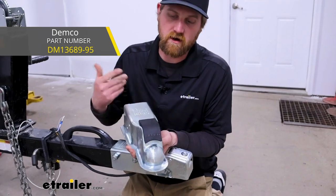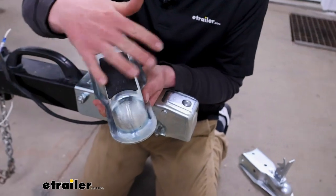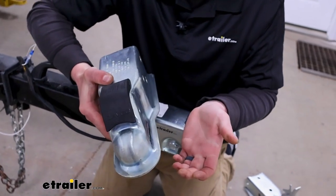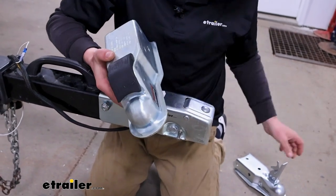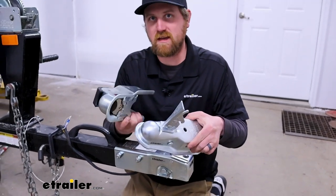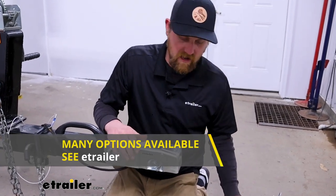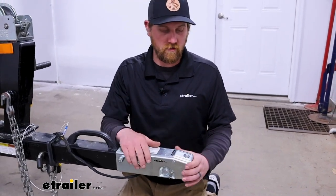Like this Demco one — these are actually pretty cool. It's an easy-latch design and with these you don't have to mess with the latch mechanism at all when you go to hook up. It could be in the open position, you drop your trailer on it, and it kind of automatically latches itself into place. Personally though, I kind of like the lever lock because it makes you lock it down, which gives me a little more assurance that I'm hooked up real good.